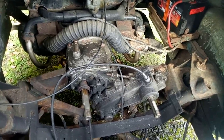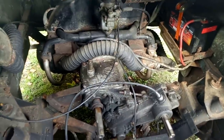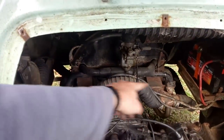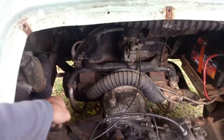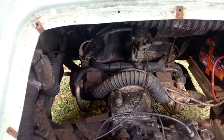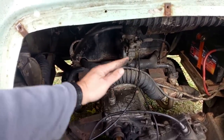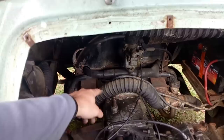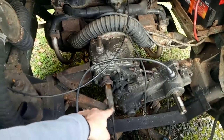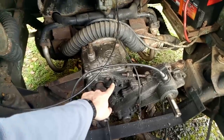Let's take a bit of time to actually describe how this transmission works. I know some of you have asked for it. So there's the engine — flat twin, four stroke, air cooled. You can see the exhaust coming out of each cylinder. Lovely smooth engine, I have no plans to change that. There's a centrifugal clutch on the flywheel, with clutch shoes that spring out with centrifugal force into a drum on the back of the gearbox. That then sends drive to this shaft, which has number one pulley on it. And that's the gear selector there.